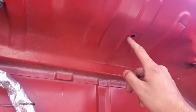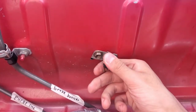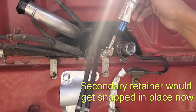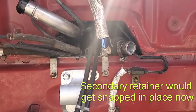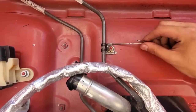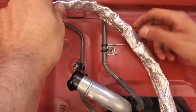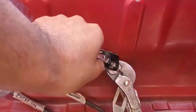I'm pointing towards a small hole in the engine bay. Directly mirrored to this is where you need to install a bracket for the fuel line. On the other side of this hole is just some insulation, so you can easily install a nut and bolt in there. I just took my old fuel rail guide, bent it to shape, and installed it. You can also install another guide that shares the same bolt hole as the brake booster line — this makes it unnecessary to put rivets in the chassis. These guides are very important; otherwise the fuel line would touch the header.